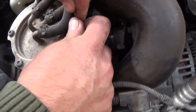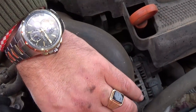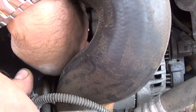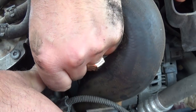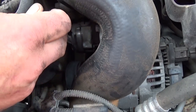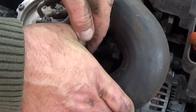You need to go clockwise and it will release the belt. Once you do that, there will be a lot of pressure, but you can just go ahead and pull the belt out. It's really limited room — pull it out from the alternator like that and now you can let go. Just be very careful because that thing is spring loaded. And that's the belt right there, still holding a little bit on the alternator pulley.